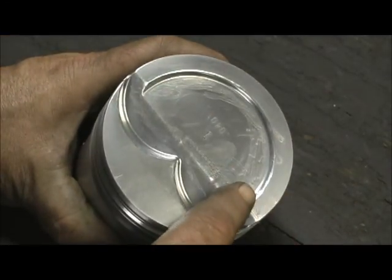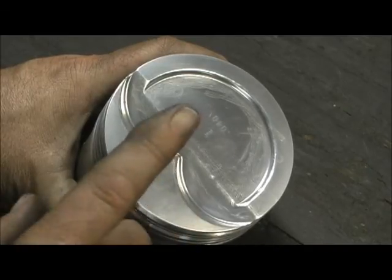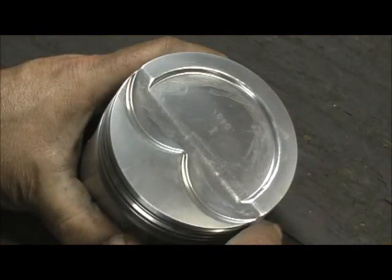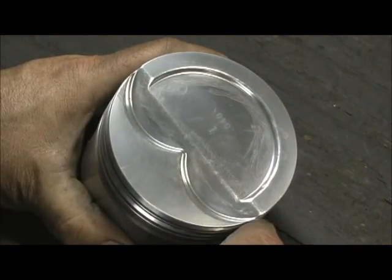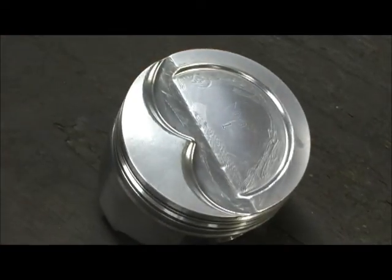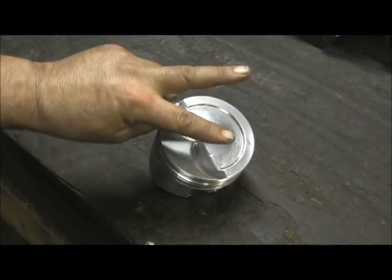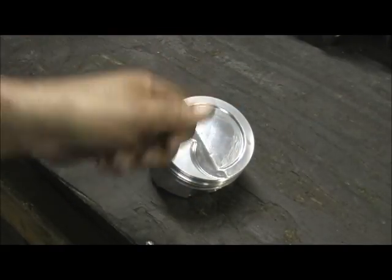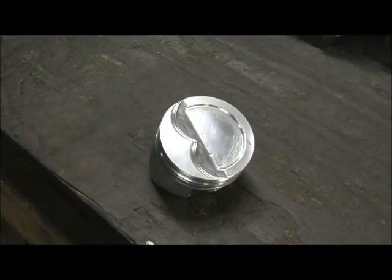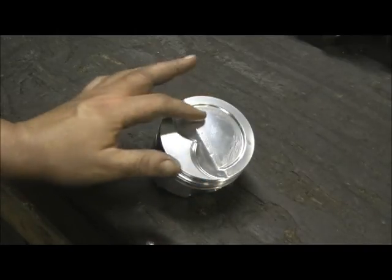This is a D-shaped cup, big valve relief for Holder's Boulder 336 stroker motor — 336 because it's 40 over. Anyway, there we go on the Keith Black piston showing what we've done and the polishing. It's a two-step process: a rough rubbing compound, then a fine. He uses stuff that he uses on bodywork at his body shop, which is Elliot and Holder Body Shop in Pleasant View, Tennessee.